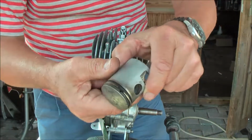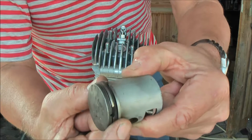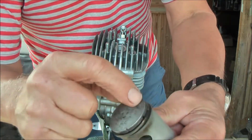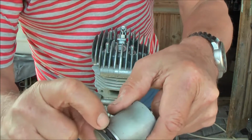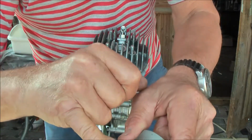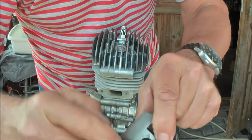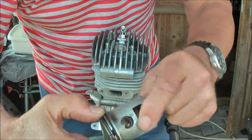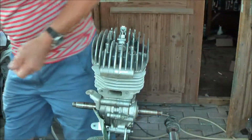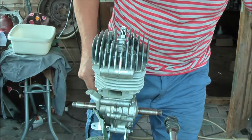While searching for the washers, I found the old piston. Look at the damage it got. The cylinder has suffered little damage. There is still a pin over there, but this pin completely disappeared. You see? And that made damage everywhere. So that was the reason to renew the cylinder, etc.